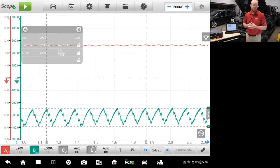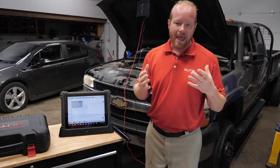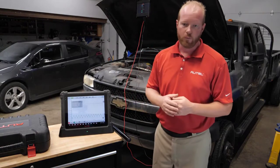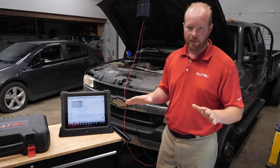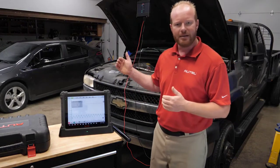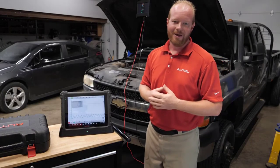Remember, this is a four-channel lab scope, so if I did have an issue with one cylinder pulling out, I could connect a third wire for a reference and see exactly which cylinder is causing issues. So in less than a couple of minutes, we're able to mechanically check the health of our engine with an amp clamp and the MaxiSys Ultra — and the MaxiSys Ultra automatically set up all those parameters for us. We didn't have to figure out what clamp, what probe, or what settings to use. Thanks for joining me. I'm Chad with Autel Diagnostics. This can be done on the MaxiSys Ultra, the MS-919, or with your MP408 scope with the accessory kit. Make sure you like, subscribe, and join us for the next one.